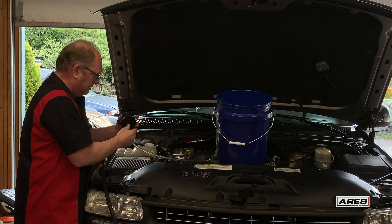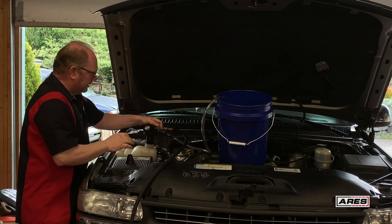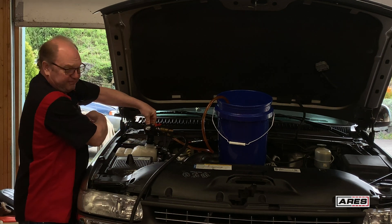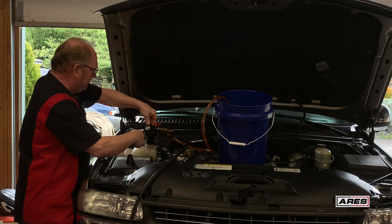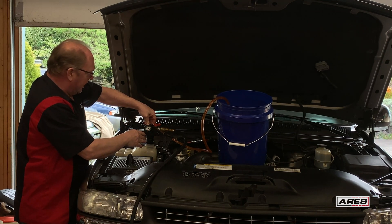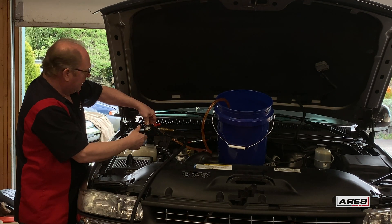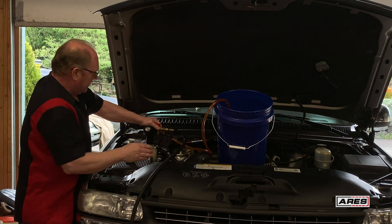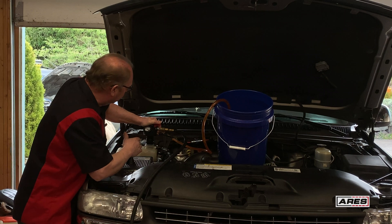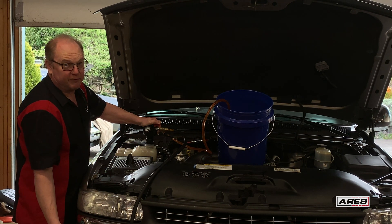Pick your appropriate adapter cone that comes with the set, hook up your air, fit it into your jug, and turn on your air. Once the air is turned on, you can purge that line — shut it off before it makes a mess. Your line is full and as you can see it's pulling down vacuum. Once you get into the minus 22 to 25 range, that's a good sign. Sometimes if you're not getting there, you could have a leak — that's what we mean by leak check. We're hitting 22 now, headed to 25. You'll never get all the way to 30; that's a perfect vacuum and it just doesn't happen.